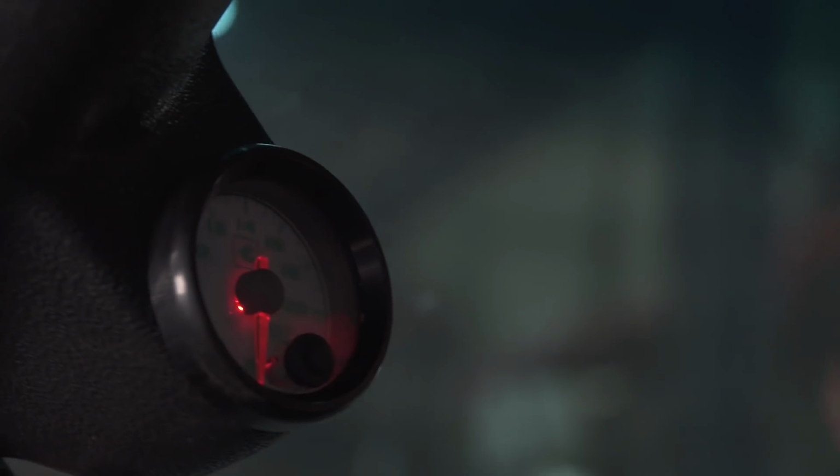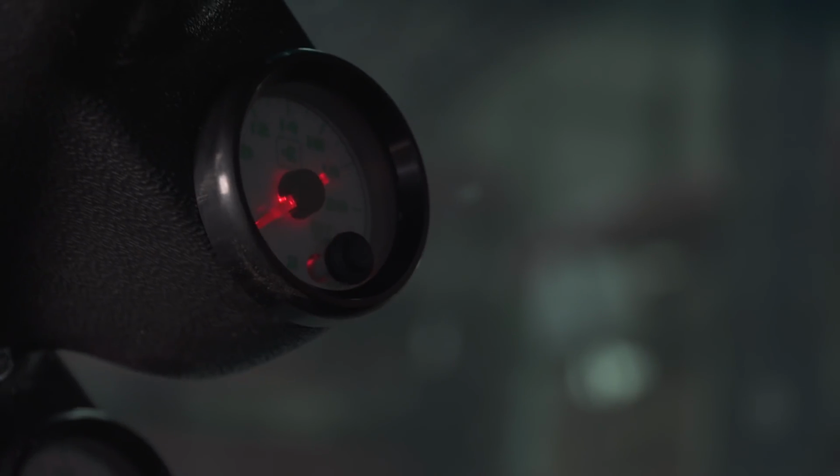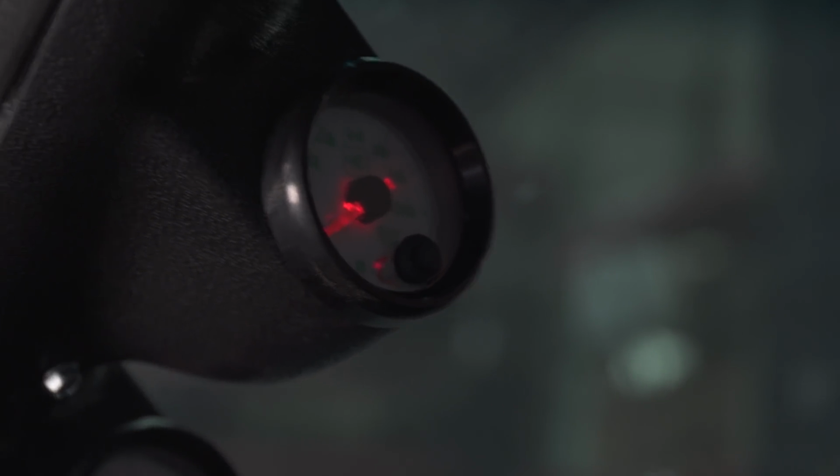Okay, let's see what the max EGT was. So in max power, it didn't pick up as much as the tow tune. 1600, right on the dot. 1600 EGT. I would say it was 34 pounds of boost, so we picked up a little boost with that. I wonder if the nitro is burning so long it's burning out the tailpipe when it's flooded with diesel that heavy.